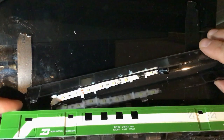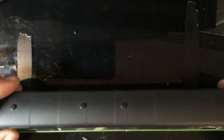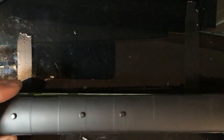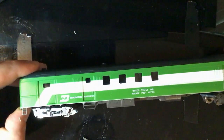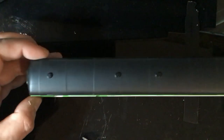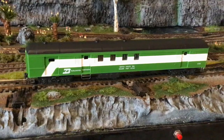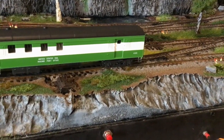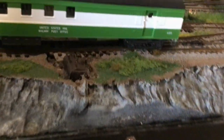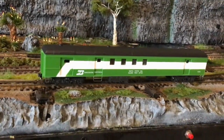Flip her over so you can see what I've done, then slide this over, check your wiring, and drop her down. That is it for the lighting - let's take it over to the bench and see what she looks like on the track. The LED strip I chose is bright white, not warm white. The reason is I want to paint them later to give them a yellow or green tinge - the white will be the best base for that. Let's apply a bit of track power and see how we go.